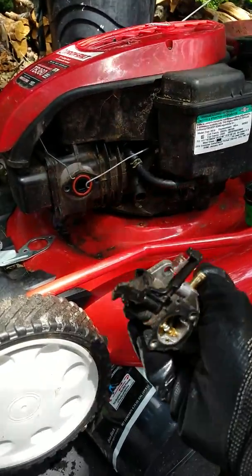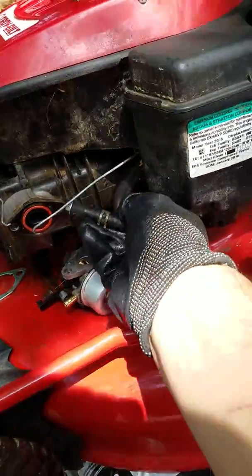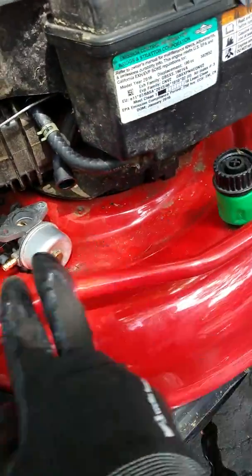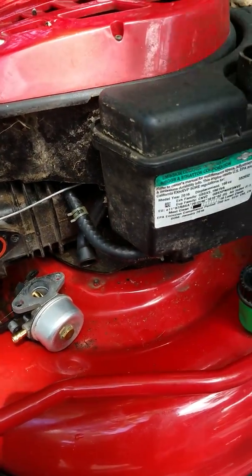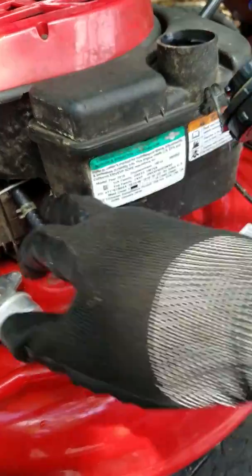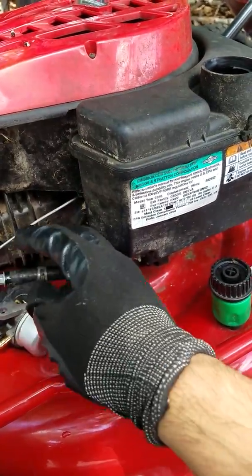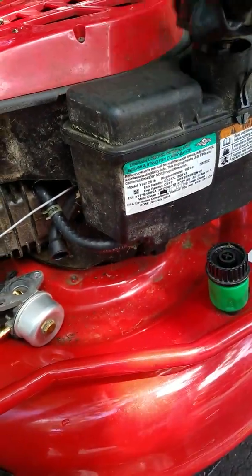Now I just drained the oil. It's kind of tricky how to get this thing off. Now I put this plug, and what you do is you just catch it with the Coke bottle. It's kind of handy that it has this bar. I just kind of hang it here. Now I just put it aside. Now I make sure the fuel tank is empty. It'll be good since this is all opened up. It's good that you put some fresh fuel or leave some leftover fuel and let this whole entire thing wash out. So I want this thing to be clean.